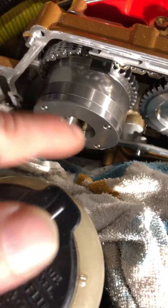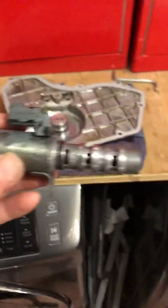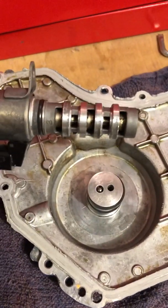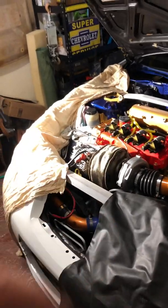This is what creates the oil pressure. It seals the oil so that when this piece — which is the intake cam gear solenoid — is in here, and when power is applied to it, it transfers oil in the rest position. When it's activated, it transfers oil through other channels and allows the phaser gear to advance or retard the camshaft.